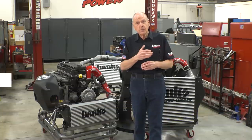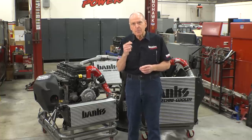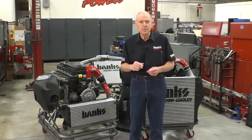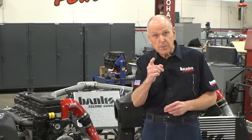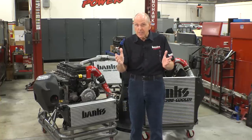The intercooler sweeps up after the compressor. If you work your truck, especially at higher altitudes, the stock intercooler chokes up pretty quickly and can't dump heat fast enough. This causes an increase in EGT — exhaust gas temperatures — and an increase in coolant temperatures, which lead to power derates. It means the engine pulls out fuel to save itself and the turbo, giving you less power and lower fuel economy right when you need it. Some aftermarket intercoolers we've tested look great on the flow bench, but turn out to be worse than stock on a high-power pull at sustained load. In my opinion, those things are pure bling, designed by companies using incomplete testing equipment and very little talent.